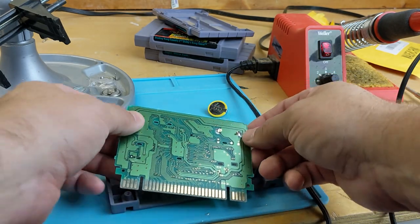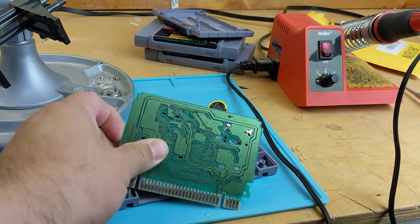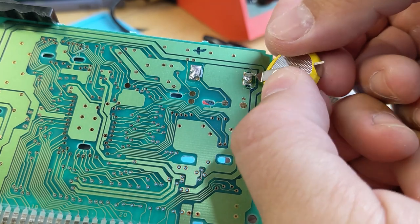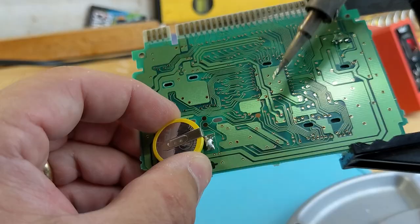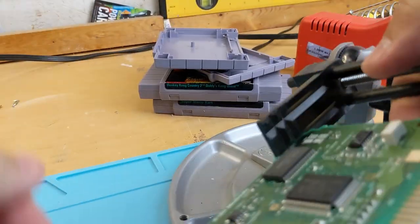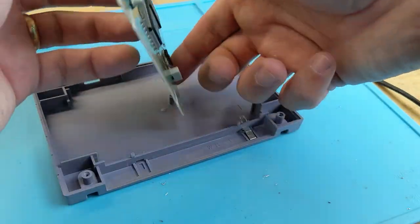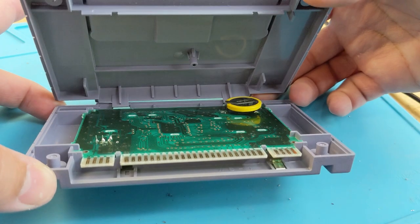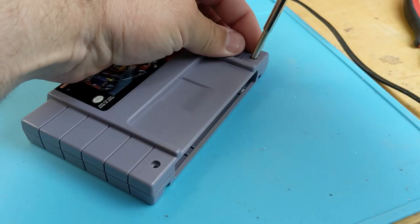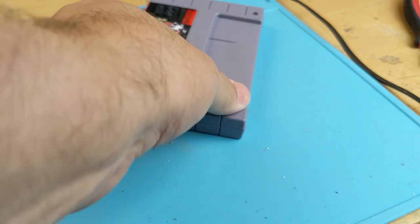When using this method, be sure to mark where the positive side is on the back so you don't get confused — Sharpie works great. Next, trim off the leads from the old battery and add a bit more solder to have a solid place to attach the new one. This is just a matter of attaching the good battery in place with some careful bending of the leads and tacking it down. Then snip off the old battery and that's it. While it may look a bit odd, it'll work just fine. When reassembling, you can peek inside to verify how much room you have. Now I can finally sleep at night knowing my beloved Stunt Race FX lap times are saved.